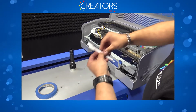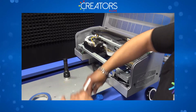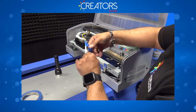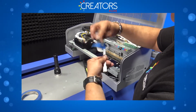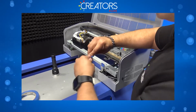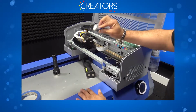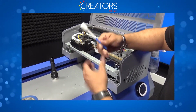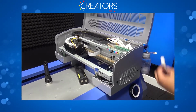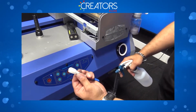I'm going to put your swabs like this, flat. You want to tape them together. All right, cool. So this is your end result. This is very handy. I like to use this a lot to clean the encoder strip. So grab your swabs, and you're going to spray a little bit of alcohol, not too much.